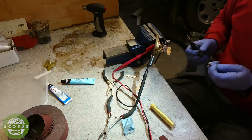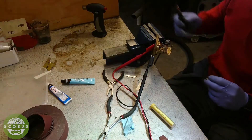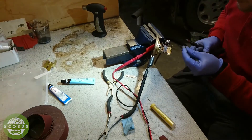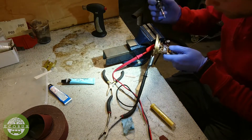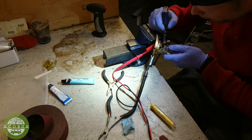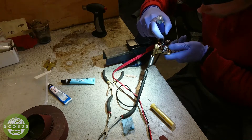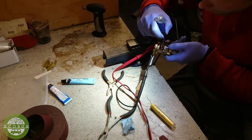The epoxy has dried up and I've mounted this plate with the wire in the tank sender. But I was a little bit slow — I coated it all with epoxy and this is the pickup, which needs to have contact with the resistance wire. I thought the epoxy would be a little bit soft so I could scrape it off, but it hardened. I tried sanding paper but found that the epoxy kind of dissolves with heat, so I'm heating it with the soldering iron and running it over the wires — that way the pickup scrapes away the epoxy where it needs to go.